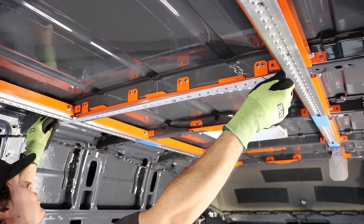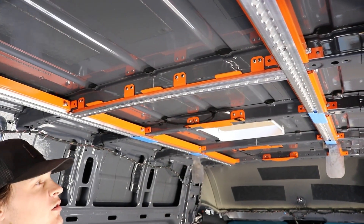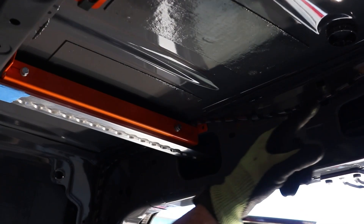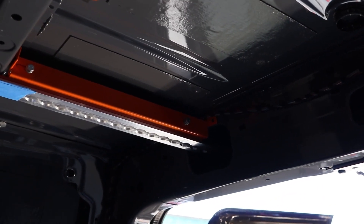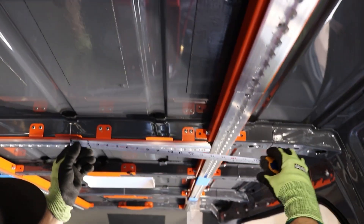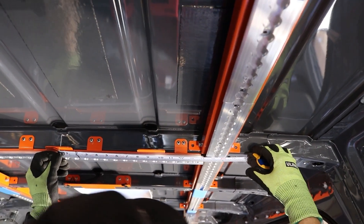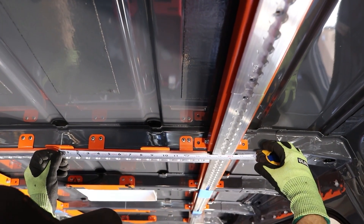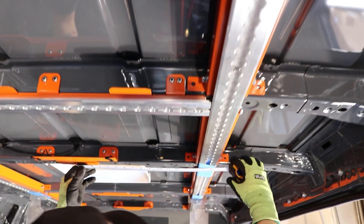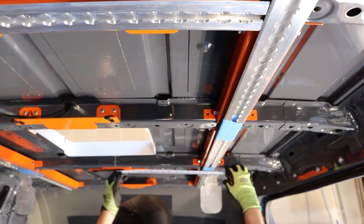In the aft section of the ceiling, your track actually goes into an opening in the D-pillar of the van where there's an adjuster bracket. Make sure the harness is above your tracks — if it's below, it will interfere with setting your panels and rear trim. Getting both ceiling bracers into the van at once before setting any rivets is really useful so you can confirm everything is parallel before setting anything permanently. There's enough tolerance and shifting that can happen even just getting them into place, so measure throughout.